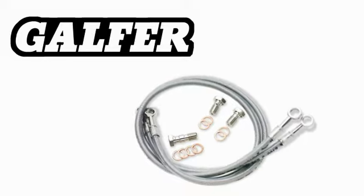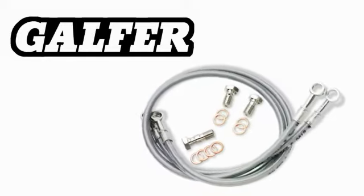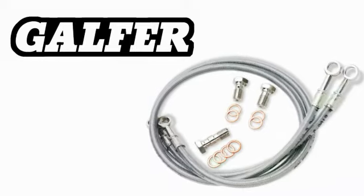What is a brake line? A lot of people ask us why do we want to replace our stock rubber hoses with a stainless braided line. The reason is that over time and through different heat cycles, the rubber in those stock brake lines is going to break down. What we want you to do is replace it with a stainless braided hose, which is going to reduce the amount of expansion in a brake line, so you won't have that mushy lever or bad brake response over time.